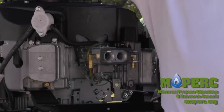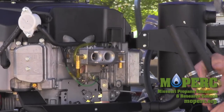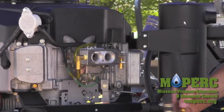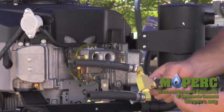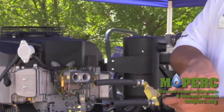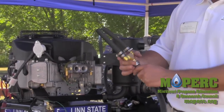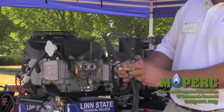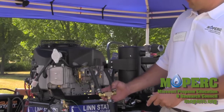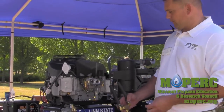The kit also supplies a T-supply line and an adapter. Since it's a two-barrel carburetor, we need to supply equal amounts of fuel to each side. If you came in through the bottom and out around off this T, you can see that the supply would give a heavier fuel supply straight through than turning the corner. So it is important to come straight in the bottom of the T and out off the side so that you have equal fuel to each chamber — otherwise one cylinder gets all the fuel and the other doesn't, and you'll be running on one cylinder.